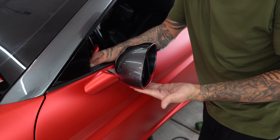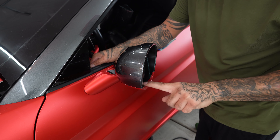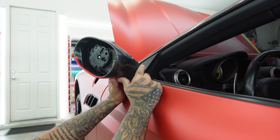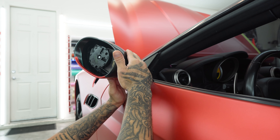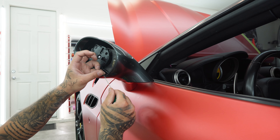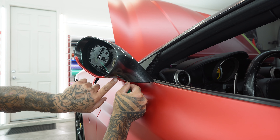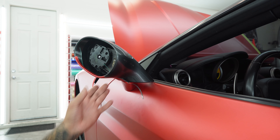So now that I actually got this piece done down here, I've worked to my edge. The knifeless tape in here — I'm going to pull at the end and it'll just be one smooth cut with all the pieces. So you can see now — here I have this piece here, there's a piece down here. Now this piece is going to face down, and this side is going to be down a little bit more. And then the other side is going to wrap around it, so they're going to all cover up. I'll give myself about an eighth of an inch — which is the green edge of the knifeless tape — I put it right on the edge of my line for my inlay. And now I want to come up here. If I choose this hard body line here, which I actually am, now that it's coming together, I can see where I can actually get away with it.